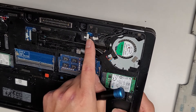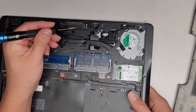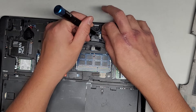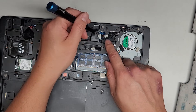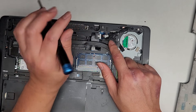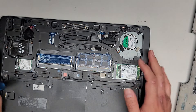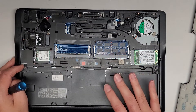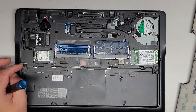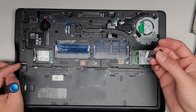The DC jack — you can pull this back, but it's pretty tough. I use a small flathead screwdriver to push on it while wiggling and pulling, and it helps to remove the LCD connector first. To actually replace the charge port, you will have to completely take apart the whole computer. I pulled this connector out and tested with another charge port, and that didn't solve the issue.